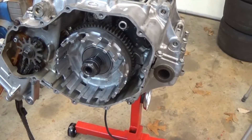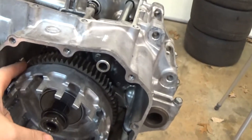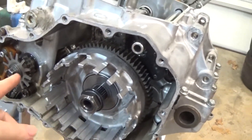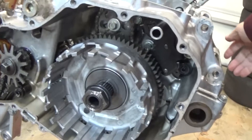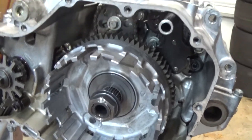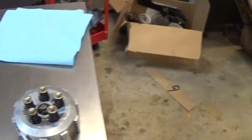Your oil pump is driven by a little gear right here. This is a multi-disc, stacked-disc clutch — you can see it here. This is a gear-driven part, driven off the crankshaft. So the crankshaft is right here, and when the crankshaft spins this spins, and the shaft going through the center is actually on a bearing so that the shaft can spin independent of that outer housing.